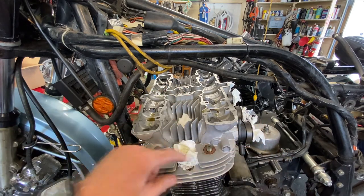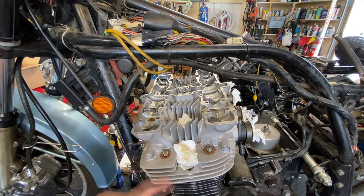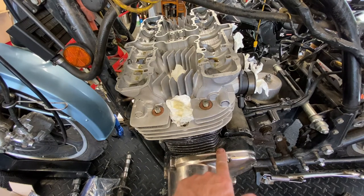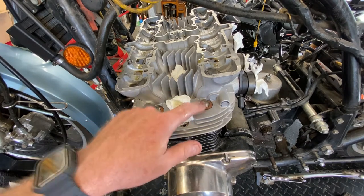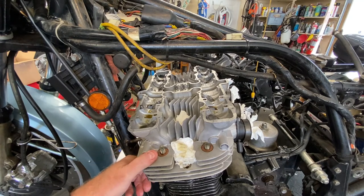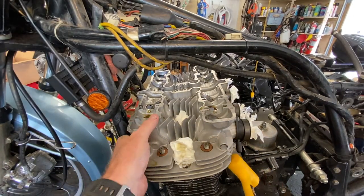Sometimes these brass, there's four copper washers on the head. Two on this side, outside, and two on the other side, because these are actually oil passages. The cylinder block is larger where those holes are in oil. I forgot which one is up and down, or if they're both down, but I think this is the pressure side because the main oil gallery is right here. It runs across. At any rate, that's why they're like that. They have these up here to seal them off because they're under some pressure. Not that this engine has a lot of oil pressure. Being roller bearing mains, it might generate 2 or 3 PSI when it's hot, running at 4,500 RPM or whatever it is, maybe 6. So it's not a big deal. But anyway, I digress. We don't want to digress too much. And I certainly don't want to chip anything. So let's...